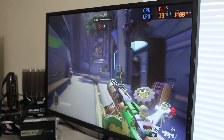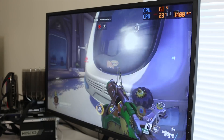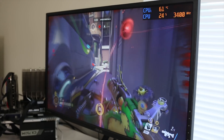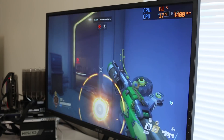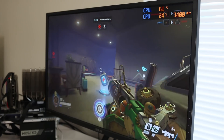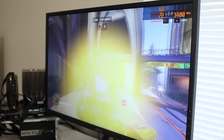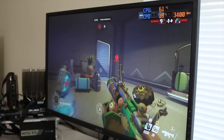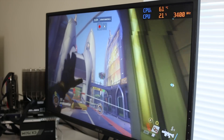After I was finished, I went ahead and let the CPU cool back down, and then I ran a game of Overwatch just to see how this solution would perform in a gaming setting. The Ryzen 5 1600 only ever got into about the 60s degrees Celsius, so you're never going to have to worry about frying your CPU in that type of gaming scenario. Other games may take more advantage of the CPU cores and threads, so your performance will vary game to game.